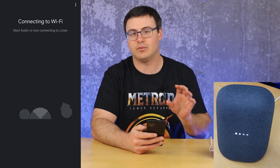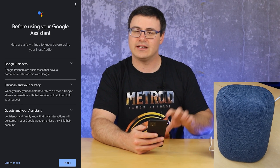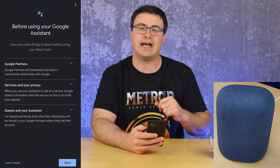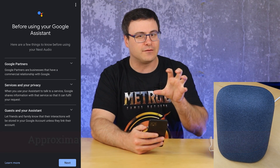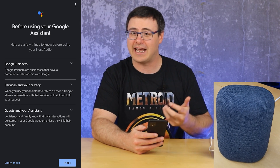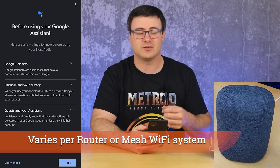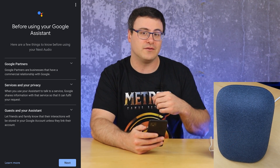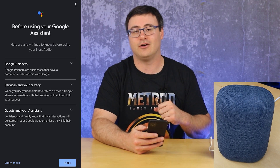For you, you probably just had to put in the Wi-Fi password. I've already done that on a number of devices and saved it — that's an option you'll get here if you haven't already done that. It's made the connection successfully. If you're struggling, it might make sense to move this closer to your router for that initial setup. Also, if your router is full of devices — which can happen around 20 to 30 devices with some ISP routers — you might want to turn a few off to make that initial connection. This might also signify your Wi-Fi system is getting overloaded.